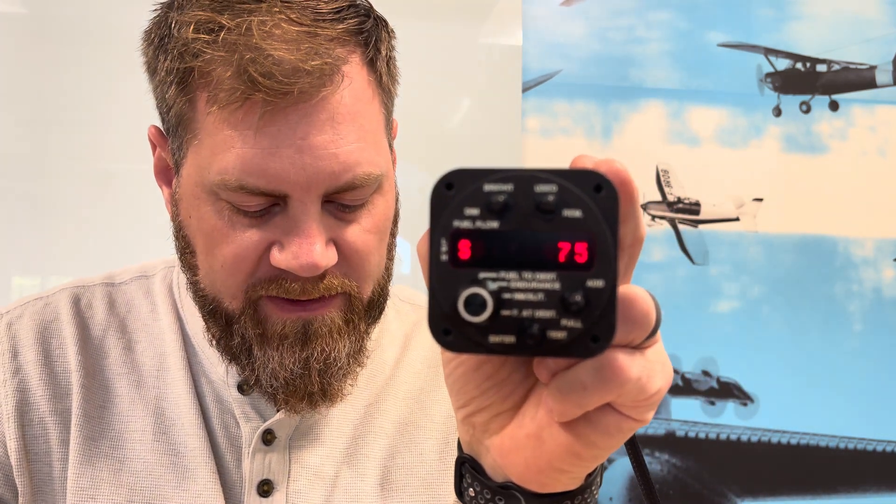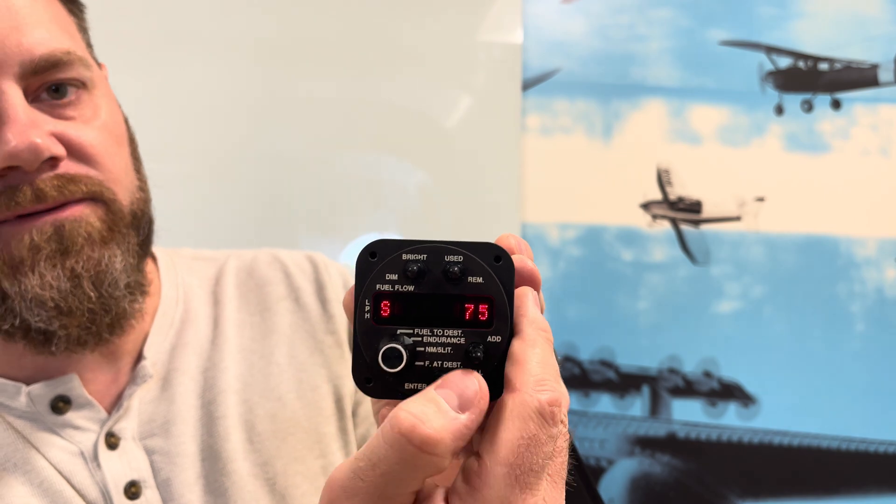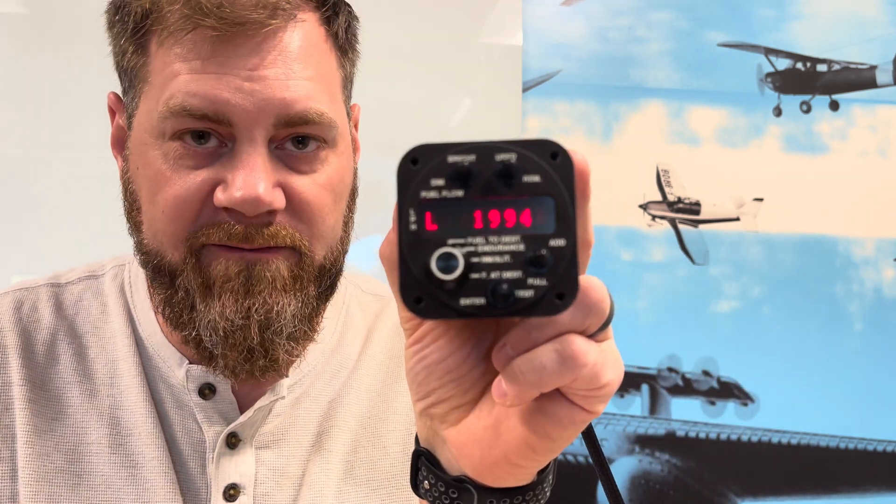Next is 'S' as in Sierra — this is your low fuel level warning. Where the endurance warning is time-based, S is volume-based: you can set a specific value of gallons or liters remaining in the tank, and if the fuel on board goes below that value it gives you a low fuel warning. This one is currently set to 75 liters — once fuel on board reaches 75 liters it triggers the warning, which you'd have to acknowledge. This value is adjustable with the Add/Full switch. After S, hitting Use Remaining brings you back to the left K-factor adjustment screen.